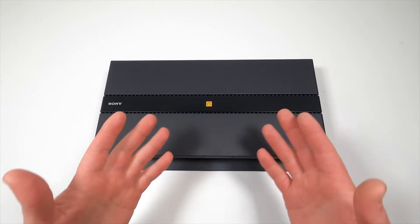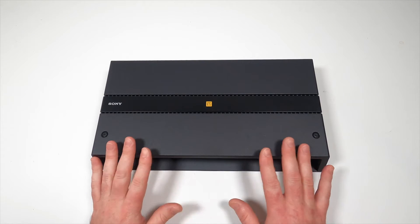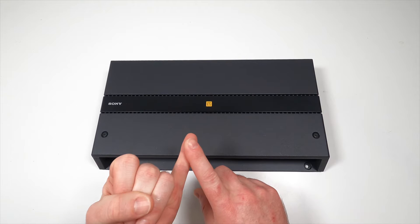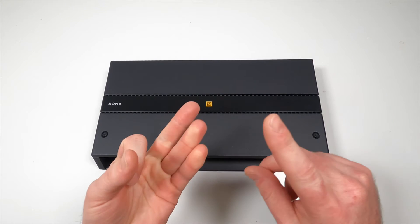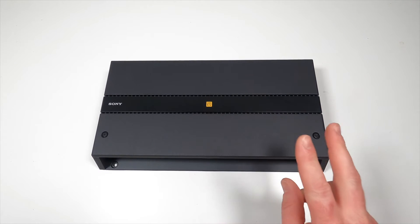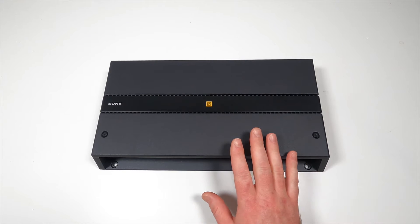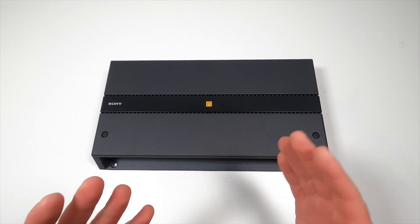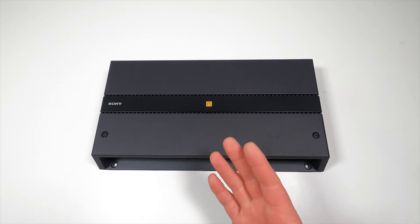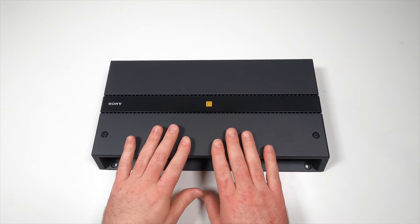Some of you might be asking: can't you do this with an inline DSP? The answer is yes, you can use a DSP — you don't have to do it directly on the amplifier — as long as the DSP has enough channel outputs for the front mids and tweeters, the front 6.5-inch woofers, and whatever else you have, like a channel for the rears. The caveat is that your system has to be wired with all of those respective RCAs. In this particular truck, the DSP I use can actually support it and has the necessary outputs, but it's only wired for a four-channel setup, so I don't have the extra RCAs to provide a dedicated signal. So I'm breaking out the mids and tweeters on the amplifier instead.